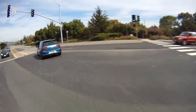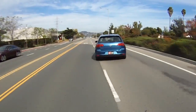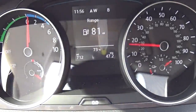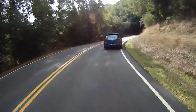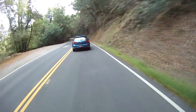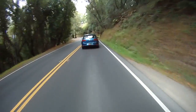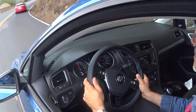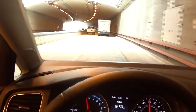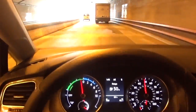The first thing I notice driving is a very quiet drivetrain. Obviously it's electric, so you don't hear a lot of noise, but you do sometimes hear gnashing and whining of gears and motors — not here. It feels quick at mid-throttle, but it's not a barn burner in terms of power. It's quick in everyday driving where you actually use the power band. These cars have a heavy feel — a different suspension bounce than their lighter gas-engine cousins — leading to a planted ride but making the car feel a little less nimble. Nothing is wallowy; it still feels pretty sharp and sprightly. In Eco Plus, the response is really muted — think ahead before you need to goose it for a lane change. Notably, they've got a special roadside assistance program: if you run out of charge within 100 miles of your home address, they'll come free of charge, pick up the vehicle, take it to the nearest charging station, and pay your taxi fare home.